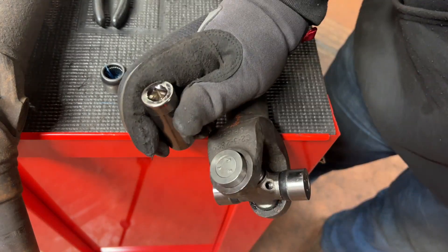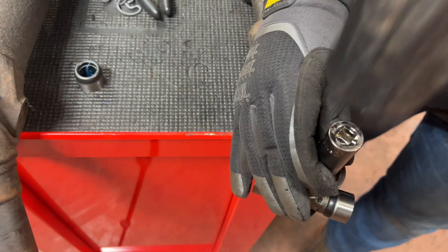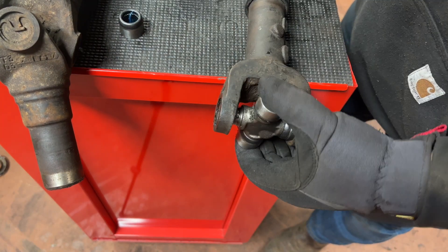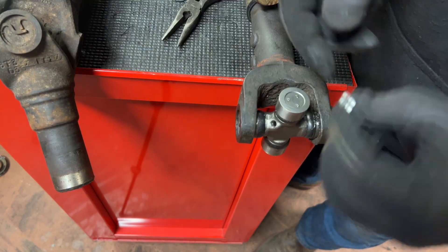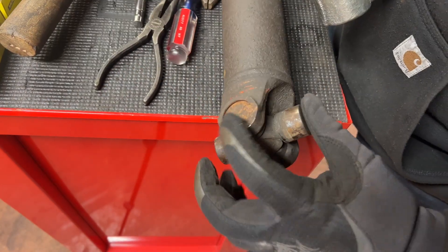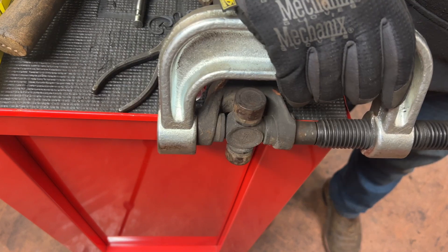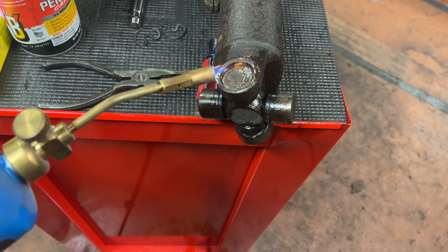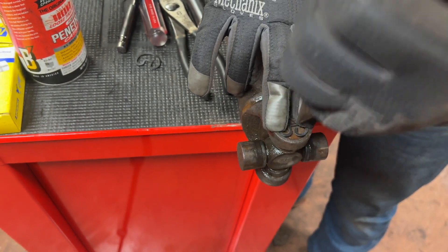Here's a new joint - take off two of the caps, get it in position. To hammer it, get a socket that fits pretty well, then hammer it down - what happens is hammering this side pushes the cap out the other side. Get one side started, hammer it down until it's about flush, then a little past so you can get the new retainer in. Stick the retainer in, get it compressed. Flip it around, make sure the joint goes into the cap, get the other cap on straight, put the other retainer in, and throw the grease fitting in. Front drive shaft is done.